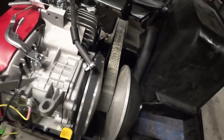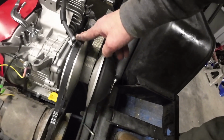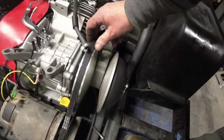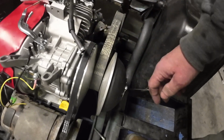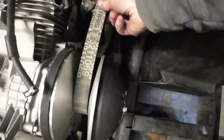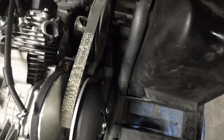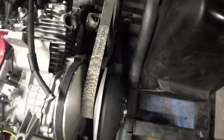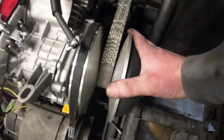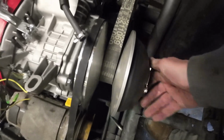The motor will straighten back out here, and then I won't have to worry about the belts getting chewed up a little bit. It's not off enough to throw the belt, but it could get chewed up. And this should be okay. The Polaris belt on here, I think it's got enough slack just now. I may adjust that a hair too, but it's got enough slack right now for the clutch to move without moving the rear end. So the starter and then the motor will turn.